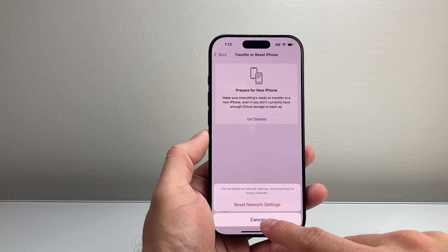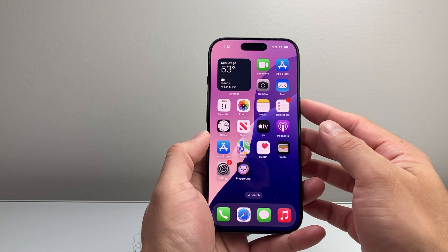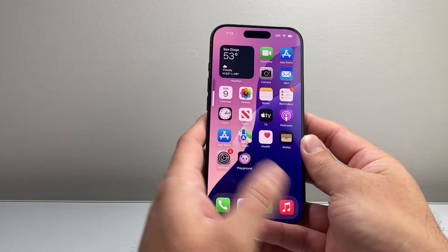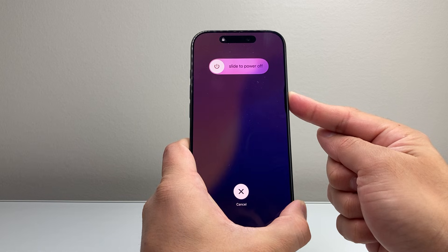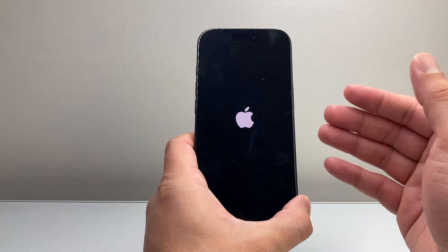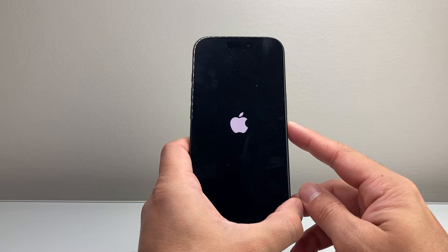You don't have to worry about that. Now, if it's still not fixed, the next thing to do is follow this step. You're going to quickly press and release the volume up, volume down, and then hold on to the side button until the screen goes completely black and the Apple logo appears. I'll do volume up, volume down very quickly, and then hold on to the side button. Just keep holding on to that side button, and we're going to wait for the screen to go completely black and then the Apple logo to appear before we let go of that side button. Then you let go, which means the phone basically shuts down and then reloads the code, which is going to be a way to fix any software-related issue that may be impacting your phone from getting no service.